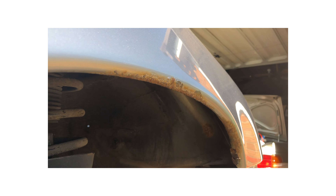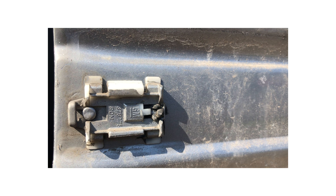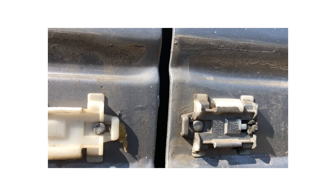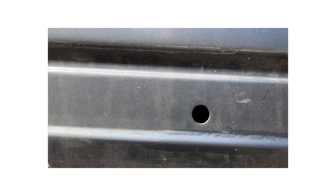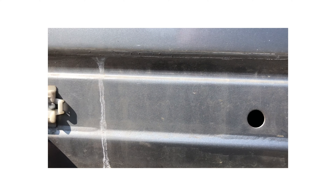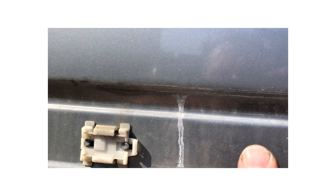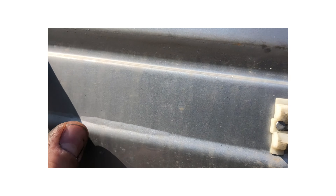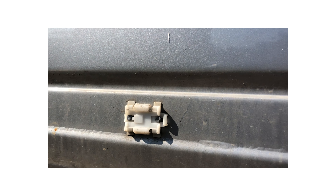Today's task is to strip off all the plastic bodywork to cope with this rust, while the head is somewhere being skimmed. The biggest problem is these clips which I need to remove to sort this out. But somebody's been rather enthusiastic with the glue, and you can see some of them are stuck in. You can also see a lack of adhesion here, suggesting they again haven't used the proper primer. I'm wondering whether to just not take those off at all, because I could mask up to that line and sand this properly. However, there's again a lack of adhesion issue — looks like some kind of micro-blistering, because the primer was probably put on too heavy and was still gassing off prior to putting the top coat on.